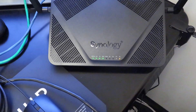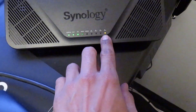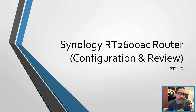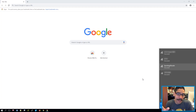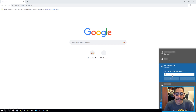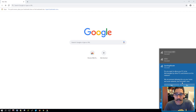The Synology RT 2600AC router has completed rebooting and everything is green. Once your router is up and running and it's time to configure it, you can use an iPad or a laptop. In this demo I use the laptop and I search for the SSID — it's going to be called 'Synology router'. It automatically asks you to insert the eight-digit PIN, but I clicked on 'connect using a security key instead.' The default password is 'synology' in lowercase. Click next, answer whatever you want, I said no — and boom, you're connected to the router, but it doesn't have internet access yet.